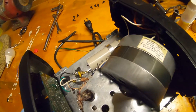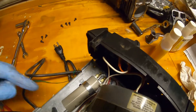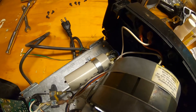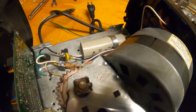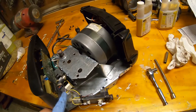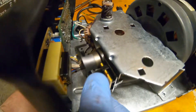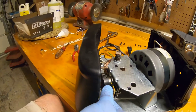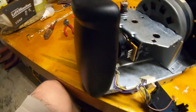The instructions talk about removing the capacitor, but eyeballing it I don't think it's going to be needed. If you do mess around with it at all, just make sure you discharge it by shorting out the different terminals so it doesn't short through you. While you're in here it might be a good idea to test it — this one says 56 microfarads. If yours is significantly off from that, it might be a good time to replace it. So the limiting switch is off, and we got that wiring harness there that just unplugs — purple's on top, yellow's on bottom.